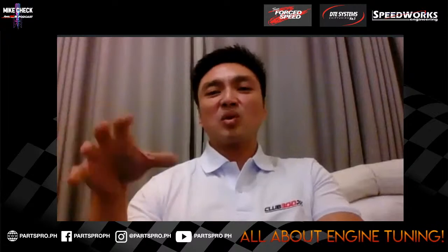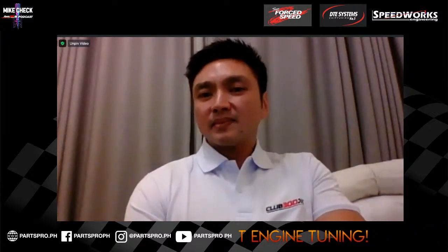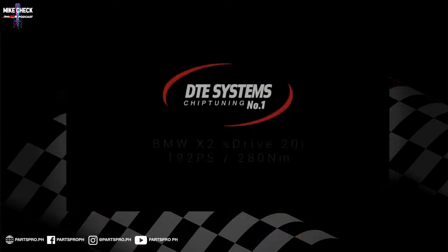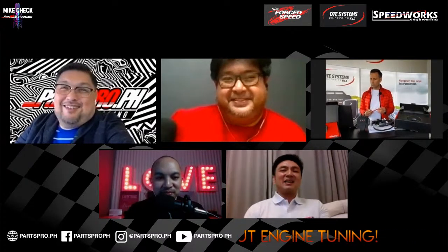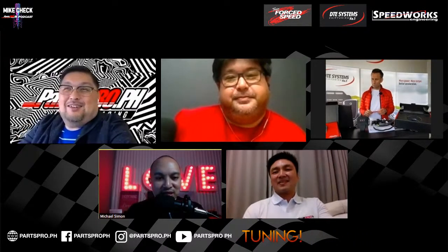What's the least amount of mods for you to hit 500 in a Supra? You would need a downpipe and a flex fuel sensor to be able to put some E85. That would make about 480 to 500 at the wheel with the flex fuel and the downpipe. That new BMW Supra engine looks like it has a lot of potential. You can run with the big boys.